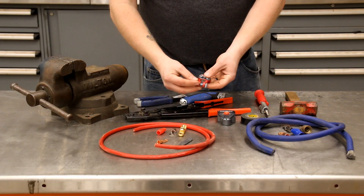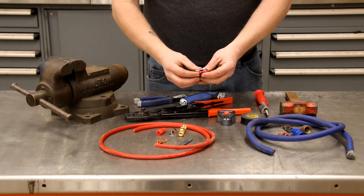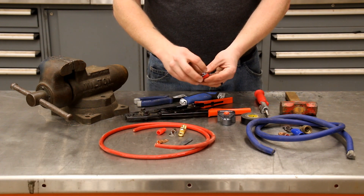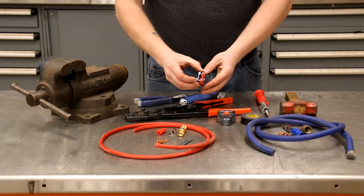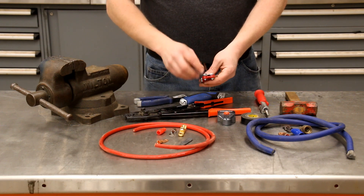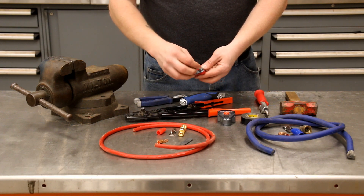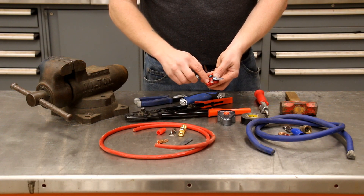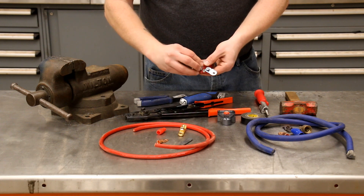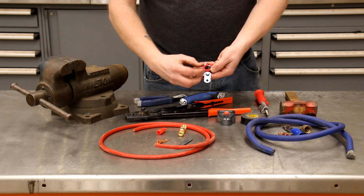This is a battery terminal right here — a replacement style. A lot of people consider these emergency style, and you can use them that way. If you're in an emergency and have to replace your battery cable, you can put the wire in here and clamp it down to get you home. These are not the best used that way. I prefer to take the center plate off and bolt a ring terminal directly here, so you can put however much you need on your battery terminal safely and securely.